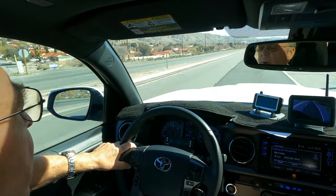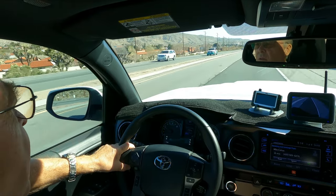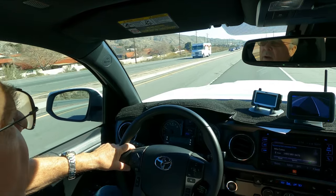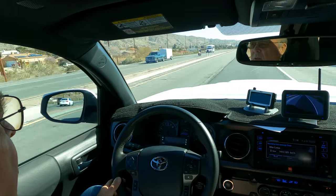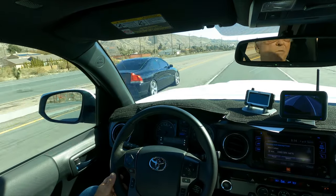The transmission is cooling right back down to 217. I think we can do this in the summer — we'll have to leave earlier in the morning because it'll be warmer, take it a little bit slower, and I think we'll be okay even without the auxiliary cooler. That's it for now.